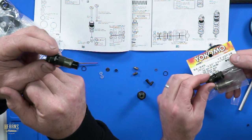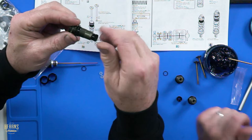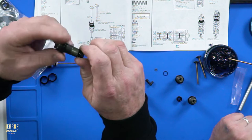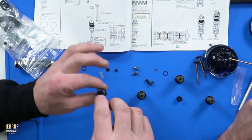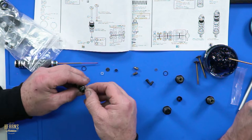Look, that's it. I've had enough of this. So with this cap, I've put the O-rings in, I've put the bush in, and then the top bush. When I put this cap on, being it's all new, I do not clamp it all the way down tight. You don't want to preload those O-rings before you jam the thread through? No, so what I do is I put some oil in there, let the oil bleed through. Then I put the shaft in, then screw it up. If that's what you say, Chief. That's what I say. No, it's just what I do.